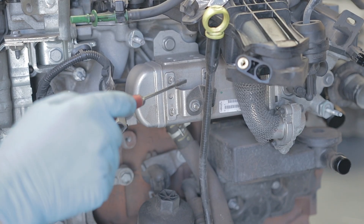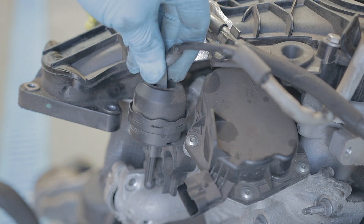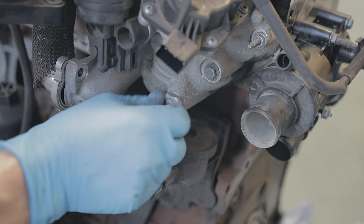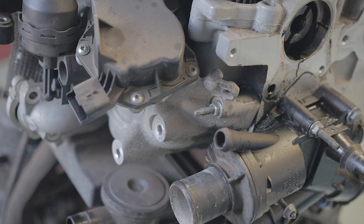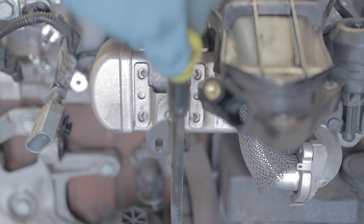The moral of the story is: if it ain't broke, leave them alone. Now we've got this whole water-cooled EGR system to remove. Two 5mm Allen keys - that's released the pipe going into the inlet manifold. Remove the vacuum pipe off your suction valve. There's a 21mm nut here with a stud coming out of it which needs to be removed, and you have a further two 10mms. There's also another 10mm holding your dipstick tube to the EGR assembly - you can just bend that slightly out of the way.